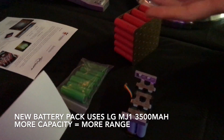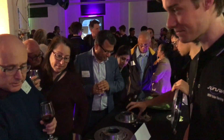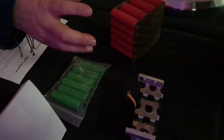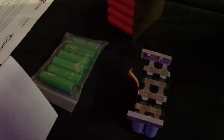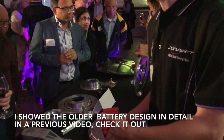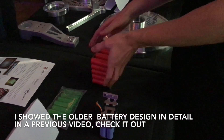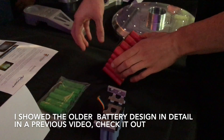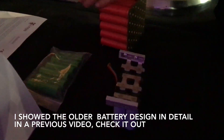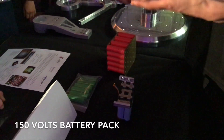Our new battery is going to be made out of these new cells, which are slightly better than our old cells — about 12 and a half watt hours. It only increases a little bit every few years. So this is the back, and then you rack them up and strap them together. There are 30 to 34 cells here, all in parallel, which gives us our capacity. We bolt these plates together in a line and weave it around the box, and that gives us our voltage — about 150 volts.